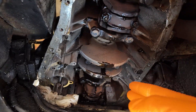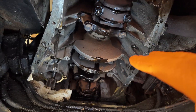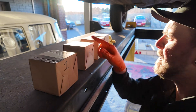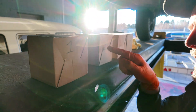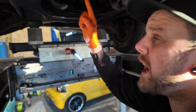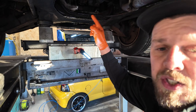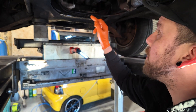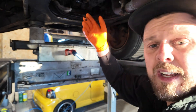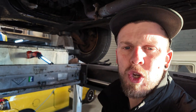What I'm going to do is take the big end shells off now. The way that I do it — and I'm not saying this is the best way — I like to get four boxes and I mark them one, two, three, four. And then I write near side and off side, so I know which bolt came from which side and which cap came from top or bottom. And then I can put these back in the same way that they came off the rod. Job done.